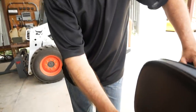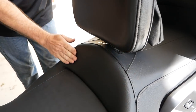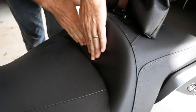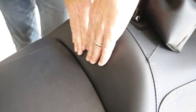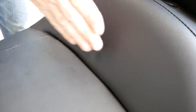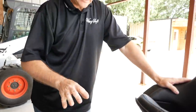And the other thing that really bothers a lot of people — I call it the large option, and anything that involves modifying this back here is priced under the large. If you take your hands and feel down here, you're going to feel a lip that runs right along this edge. You can even see when I push down up against the backrest, that lip right there. As you're sitting up against the backrest, you come down and actually sit right on that lip, and that bothers a whole lot of people. Literally 80% of the seats that I've been modifying have had that back section removed.